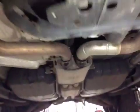All the suspension on the near side front is good. Moving to the off side front, there's 6.2mm of tread and the tire is marked in green. There's 5mm of pad left, marked in amber, and all the suspension is also good.